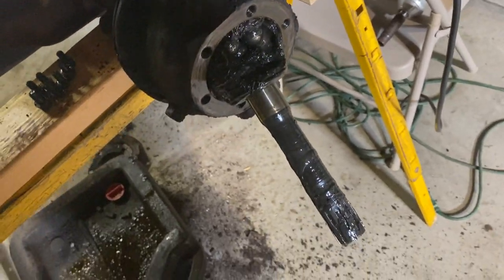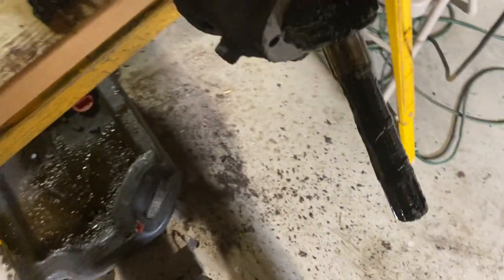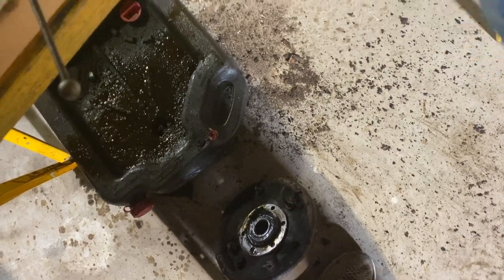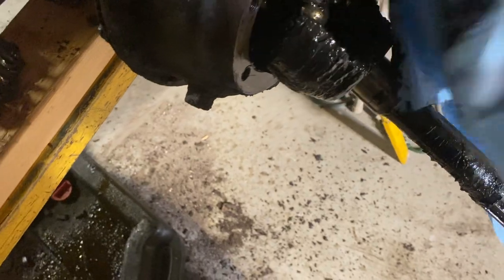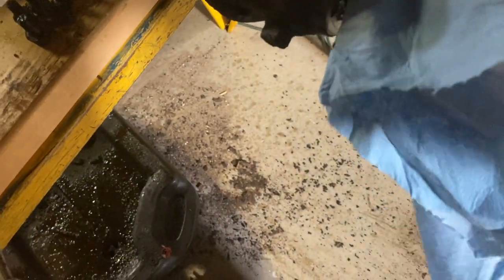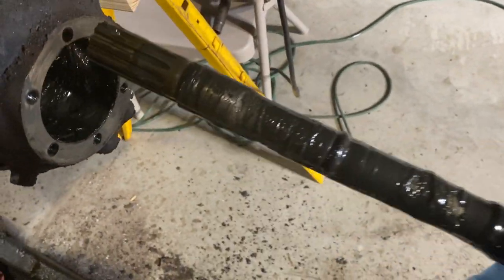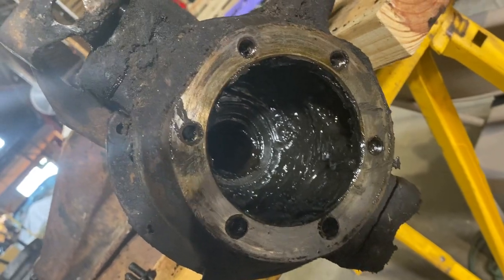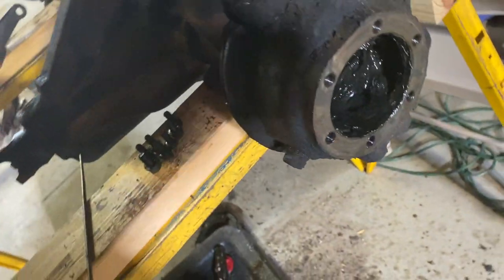Back over here — this is the one I haven't pulled out yet; you can see the balls in there. What's going to happen: we'll go ahead and pull the axle out. Grab a paper towel so we don't get grease everywhere. You're going to pull this out and it just comes right out — grabbing it up here in case it decides to come apart. So it just comes right out. This is the short side; the driver's side is the long side. Set it down in the oil catch pan, and then you can see up in there all that grease — all that has to be cleaned out and then packed with new grease.